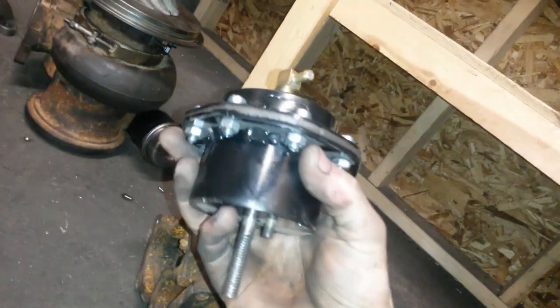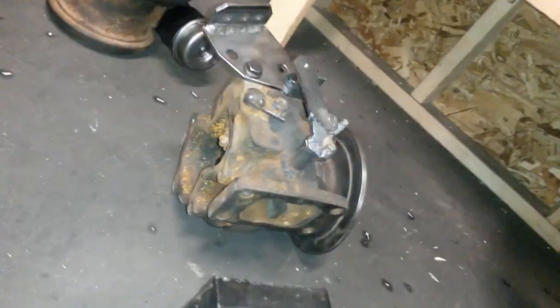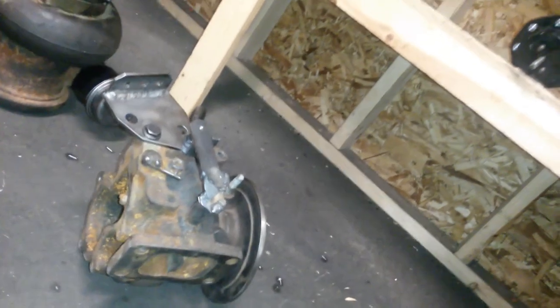Now, like we said, this guy's wastegate is pretty big, so to hold that shut, because the stock actuator would have absolutely zero chance, we have our old actuator we made years ago. I did end up cleaning it up a little bit and gave it a quick paint job. Should be pretty adequate for the job. It should look pretty good sticking out from the side of that HX35.